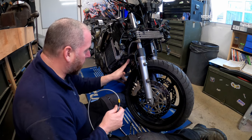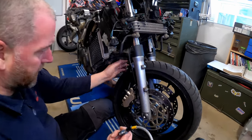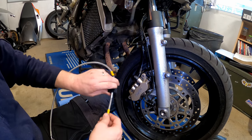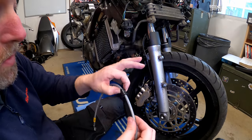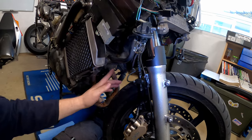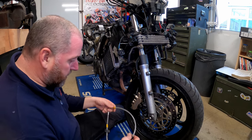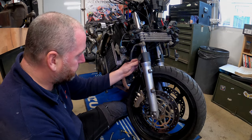There's obviously quite a lot of hoses at the front, but this is the only one that can replace this part here. As you can see, this hard line comes out that goes over to the other side, and that goes into here. Things like the angle of the banjos are a bit of a giveaway as well. Things like this: on this line here, there is only one of these on the factory one, whereas on the other side, this hose here, for example, has two, and there's another hose in the kit which has got three of these on. So obviously on the bike, the standard hoses will have three of these on. It's just a case of matching them all up. So anyway, what we'll do now is bust open these banjos and disconnect these hard lines.